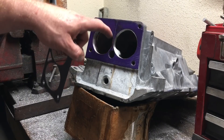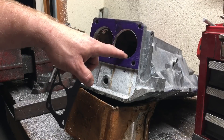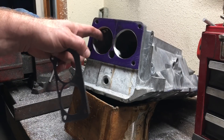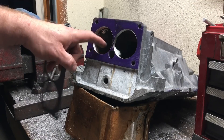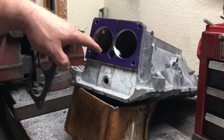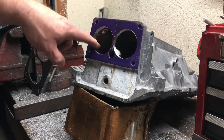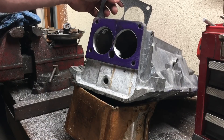Once you get basically to the line, it's up to you how far you want to smooth the finish. It can be left at 60 grit, polished smooth, or just a sanded finish at 120 grit. This finish really has no effect on how much power it's going to add or airflow — this is purely just to give unrestricted access from the new bigger throttle body to the common plenum and to the motor.